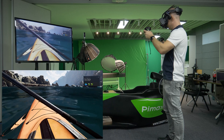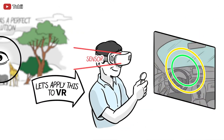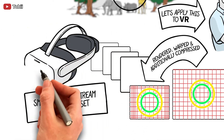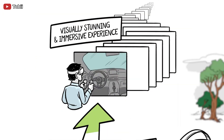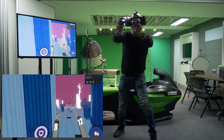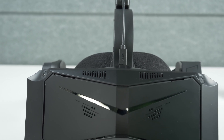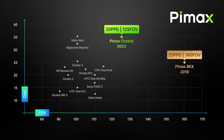This is done to lower the extreme high bandwidth requirements needed to transmit a high-resolution video signal over a dedicated protocol running at a 60 GHz network. It also uses the built-in eye tracking, and similar to how dynamic foveated rendering works, the wireless image signal is split into areas where the center-view part is rendered in full native resolution, always providing maximum clarity and sharpness. The Crystal headset renders a native resolution of 2880x2880 pixels per eye, and Pimax engineers worked for years to maintain that native resolution and the same 35 PPD — pixels per degree — over the wireless protocol. With the Air Link module, VR games run at the native resolution of 2880x2880 pixels per eye without any upscaling or downscaling — that is 16.5 million pixels in total, wirelessly.